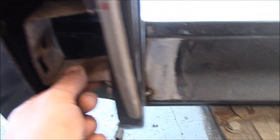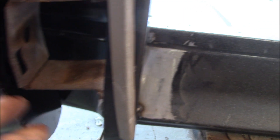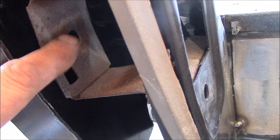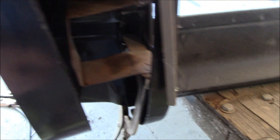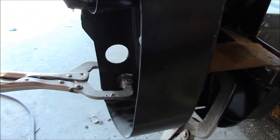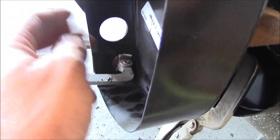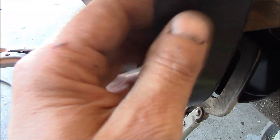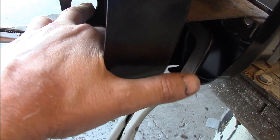This is one of the very first pieces — I told you it welds onto the back of this into the pocket, and you just spot weld it on. That indentation actually — if you can see in there, my finger is lining up with that — that's why they do that. Now, another way to align it: on the inner panel on the floor there's a hole through it and a hole through this panel that we're putting on, so it kind of lines up that way.